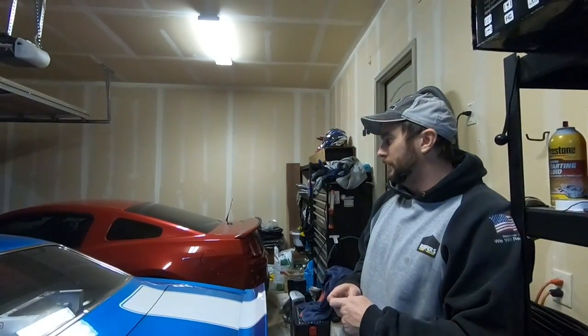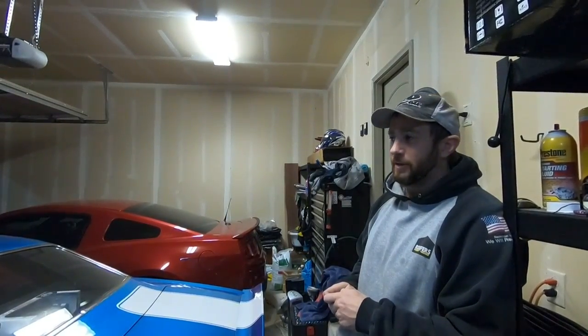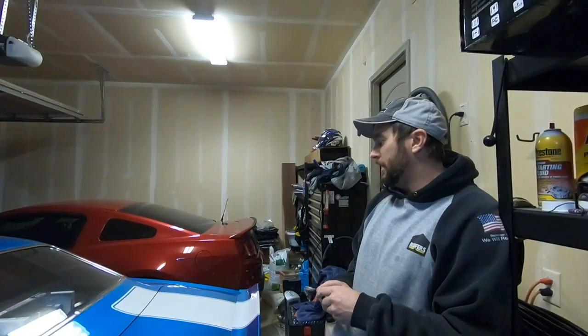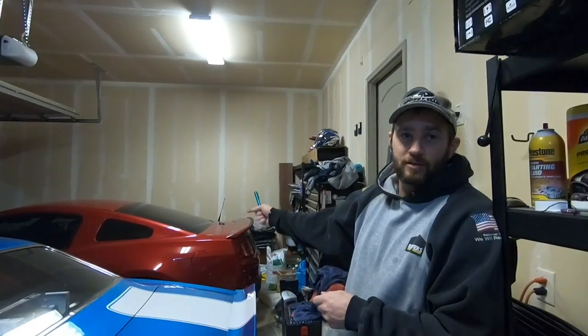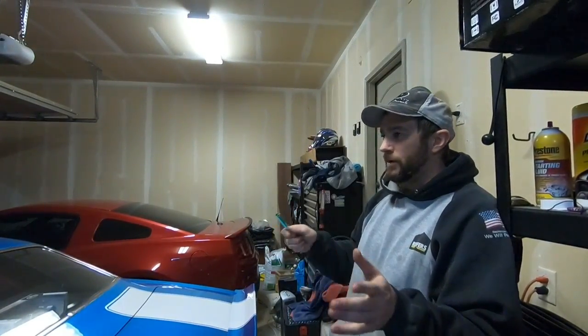Oh, what were you trapping at? 113, 115. Oh, that's still awesome. It's still up there, but yeah, it should be a 120 car, but we're not hitting that. But we're also running a 13-second pass, which is slower than a stock GT did. And granted, we're at 5,000 feet, so that's why we want fuel injection with these, because we're at elevation.